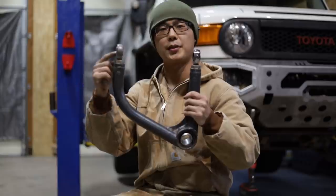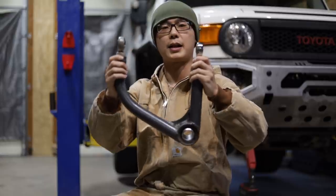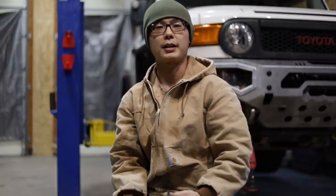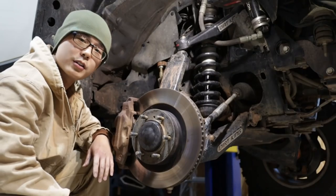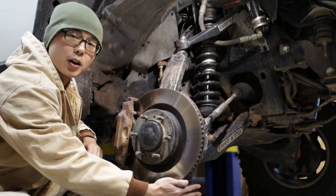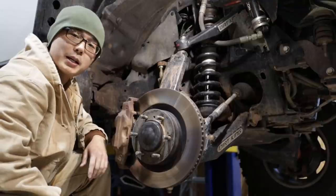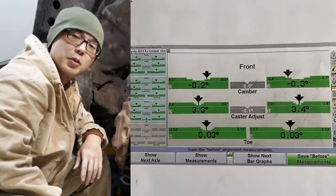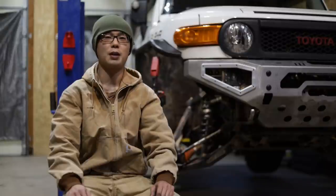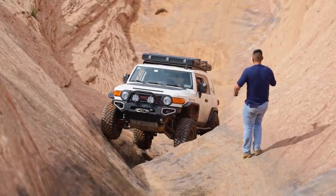These adjustments also affect camber and caster simultaneously. To keep my camber in check, I couldn't adjust the lower arm all the way forward — therefore I still have tire rub near full compression. On the Dirt King side, both the upper arm and the lower arm are shifted forward together, so you move the tire forward without introducing higher caster. On my setup, without messing with the upper control arm rod ends, I was able to get 3.5 degrees of caster, which is pretty reasonable. In my recent 4,300 mile round trip from Pennsylvania to Moab, Utah, this alignment handles significantly more pleasantly, and I never had any tire rub when I flexed on the Moab Slick Rock.